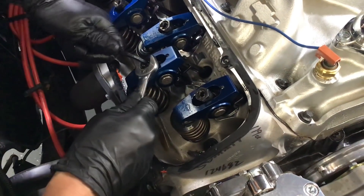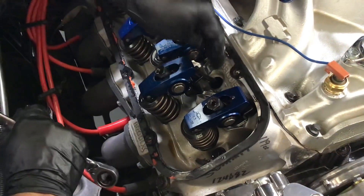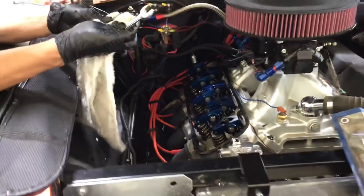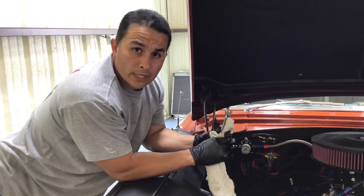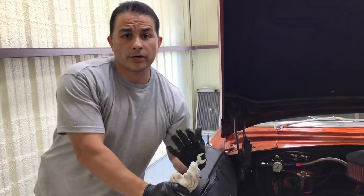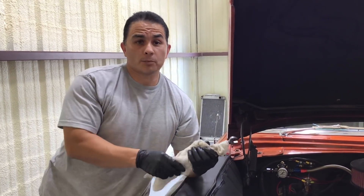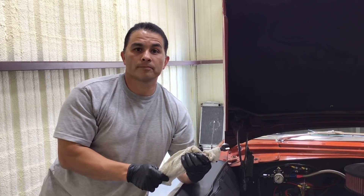Make sure you hold this down. And there it is — that one's set, that one's ready to go. That gives you enough push on the hydraulic roller cam, and that's set. Again, this is a 572 hydraulic roller cam. If it's a solid roller, it's a different setup and you would have to use a feeler gauge and see what size it is on your cam — that depends on your cam. So give me a thumbs up, share this video. Hope this helps you adjust your rocker arms and get a good running engine. We'll see you on the next one. Thanks for watching.